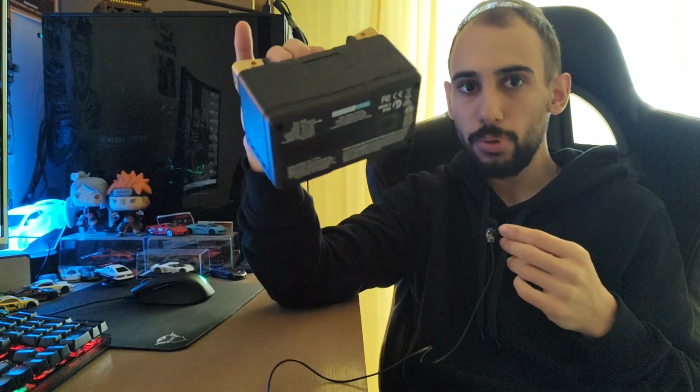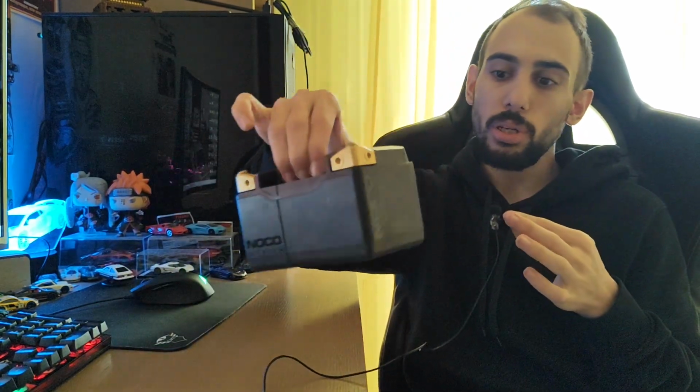This one is not even a kilogram, so you already lose like 13 or 14 kilograms. Then you don't really need all that heavy, metallic adapter and plate for the stock battery. You can just completely gut that and make a 3D printed nice little holder, or even do a DIY aluminum plate above it and stick it wherever you can on the bottom of the engine mount that has a small hole. So yeah, we're talking 15 if not more kilograms of weight reduction with 3.6 Ah.